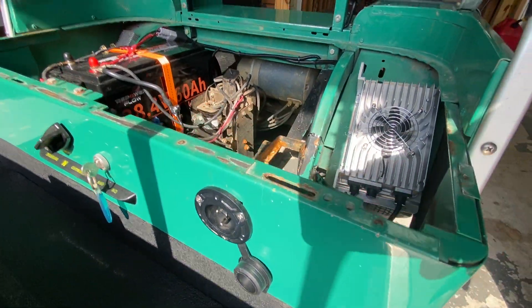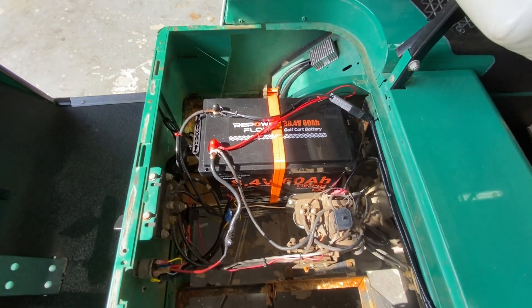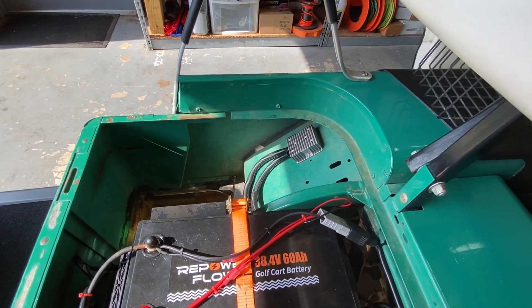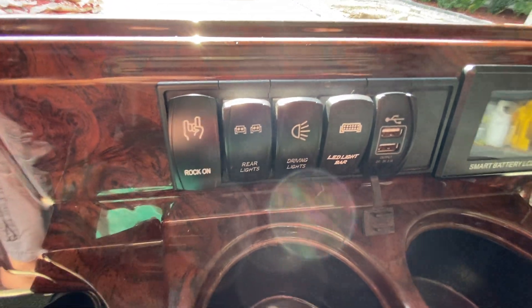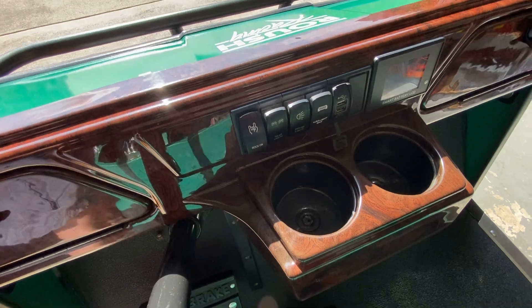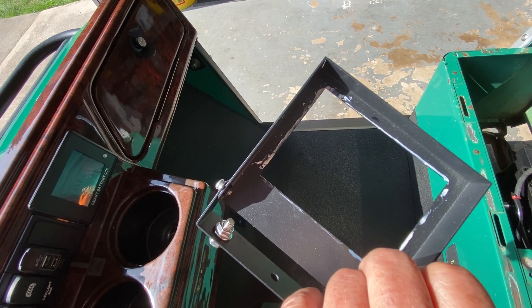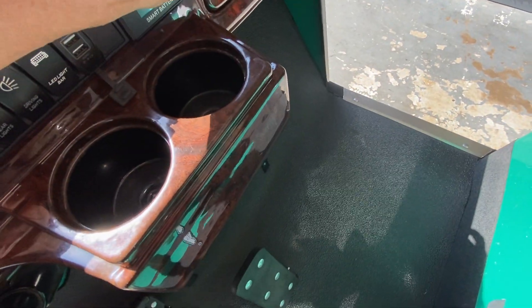I run a lot of 12-volt accessories, and I used to tie into two of the six-volt batteries to make 12 volts. Now with just the 36-volt system, I put in a 36-volt to 12-volt reducer to power all my 12-volt accessories — things like a stereo system, lighting, and that kind of stuff. The battery monitoring interface that comes with the battery mounts in the included bracket, but since I have a dash, I used that bracket as a perfect template and installed the monitoring system directly into the dash.